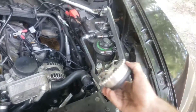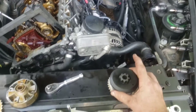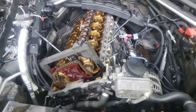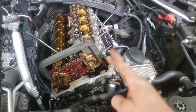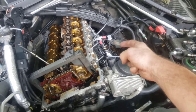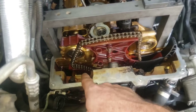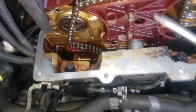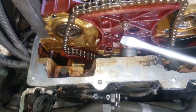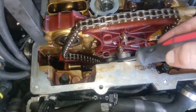Because my problem was just that I needed a new Vanos assembly — link in the video description — I'm just replacing the Vanos. What you're going to find is once you've taken these out, it's going to be really hard to stick it back in. I haven't done this part yet so you're going to have to get creative. My main point of this video is to show you how to lock the crank and cams in place, because I didn't see a video showing that. Next, there's a timing chain tensioner, so you're going to take a big flathead screwdriver and come from this side.